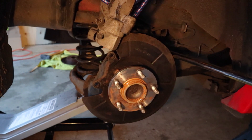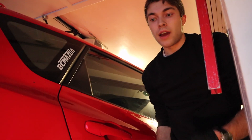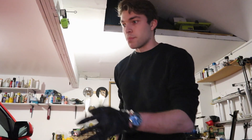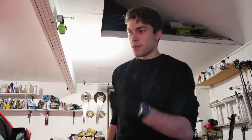Dude, that was butter! That was actually butter - things usually don't go this well at Arseny's Auto Repair. We have one more bolt to crack loose on the front of the trailing arm and then two more bolts on the actual bushing part that are parallel to each other. We're going to crack this bolt loose on the bottom, get that one out, get the ABS sensor unclipped, all the connections unclipped with the plastic clips off the trailing arm, and we'll go from there.